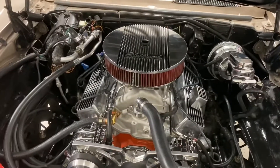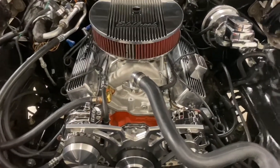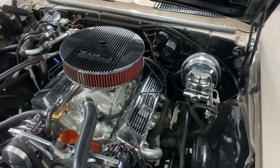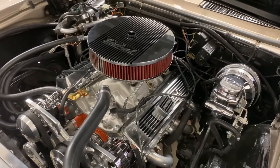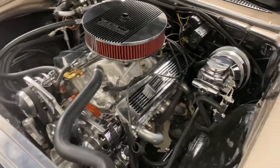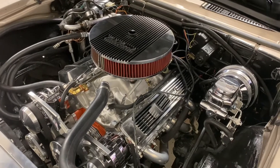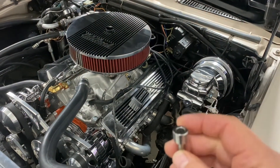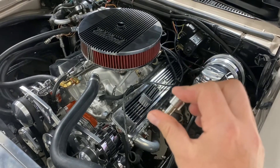Just an update video on the 400 — you can see I got new valve covers on it. The reason being is this little guy right here. I'm still not complaining about the motor, still love it, Blueprint was great, but I started hearing a clatter on the driver's side. Decided to pop the valve cover off and see what's going on, and this little roller had popped off the top of the rocker.